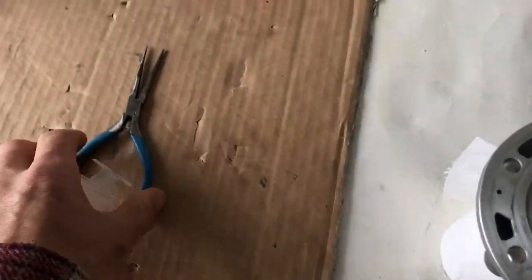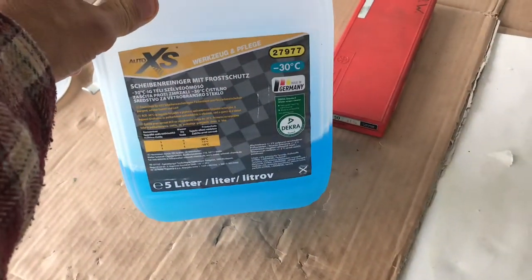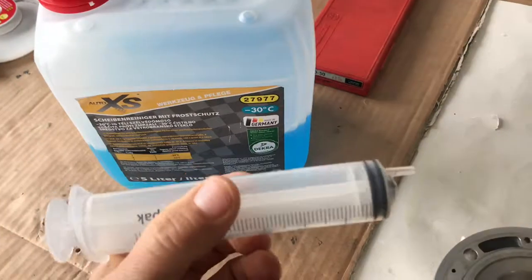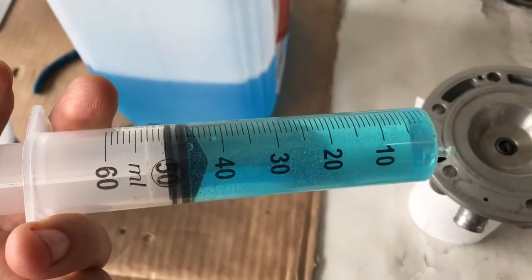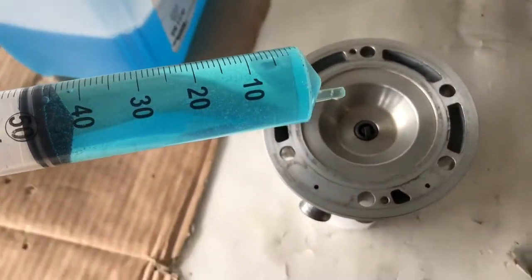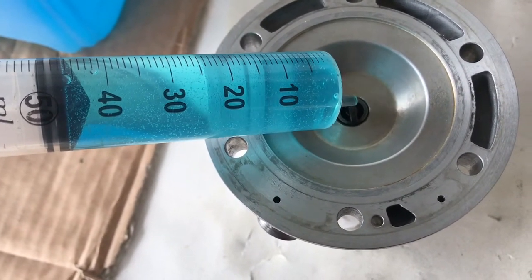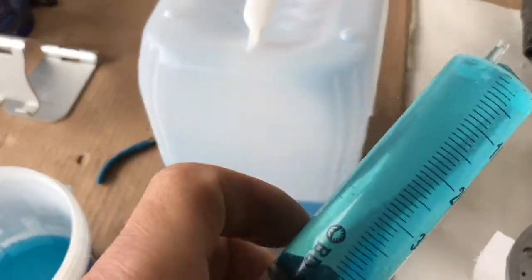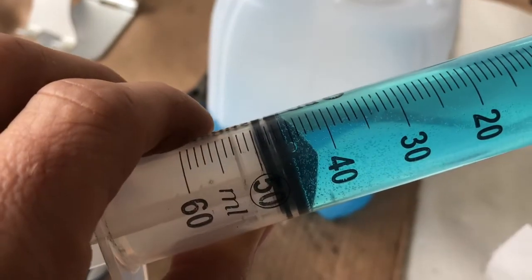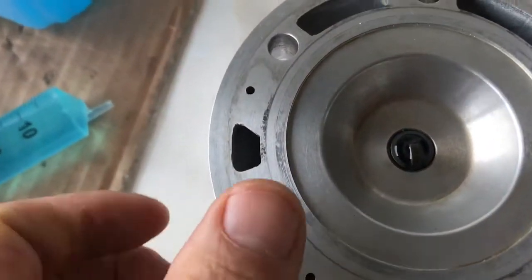Now, what fluid should we use? You can use water, but it does have quite a surface tension on it. I've just got some windscreen wiper washer liquid out of the car — it's coloured so I can see the graduations on the syringe. I'm going to suck this up and fill the plug cavity. I've got it all full — the plunger's down to the 50 line. So I'm going to very gently inject into there. Yeah, that's full. I can see roughly on there that's about 0.4 of a millilitre to fill the plug up.